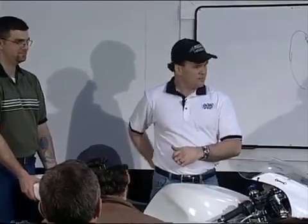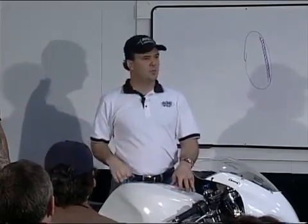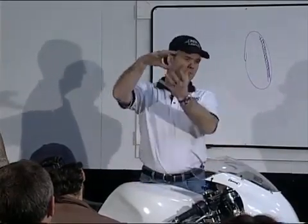So that's kind of when you mentally want to divide it, right? If you're getting it up your spine from the back of your bike, something's too stiff back there. It's not soaking bumps, right? If you had a triple adjustable shock, you'd back out a little high speed, right? But hopefully you've got the right spring rate, you've got your free sag, and so on and so forth. Then you would just know that I need to go for my compression adjuster to soften the shock to get it to soak bumps better, right? So you're trying to separate those things as to, is it something going up or is it something coming down? And that's where you want to divide it, okay?